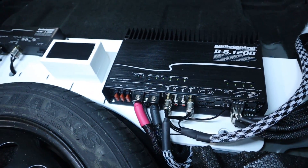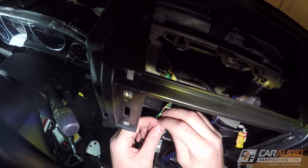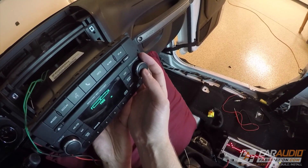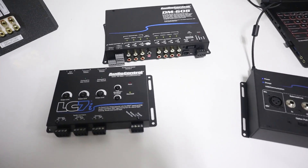When we are adding an aftermarket amplifier to a car and using the factory system to provide musical signal for that amplifier, there is a very important term we must understand called signal summing. Without proper signal summing, it's possible that we could have weak bass, missing vocals, or unimpressive highs. So what is signal summing and how do we use a signal summing device? How can we determine what wires in the vehicle we need to connect to in order to send a full range signal to our amplifier?